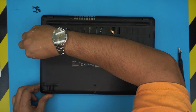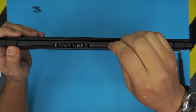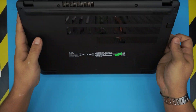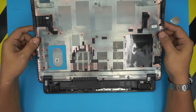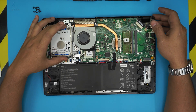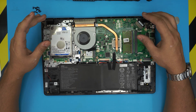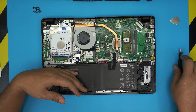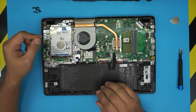Continue along the left and right sides. By the fan at the back, stick the tool in and pop those clips. Then grab the bottom and wiggle it — it should come out pretty easily. Down here you can see the hard drive labeled one terabyte — this is a mechanical drive. To remove components like RAM or the hard drive, you do not need to remove the battery. If you do want to remove it, there's a power jack cable you can pull back to disconnect.